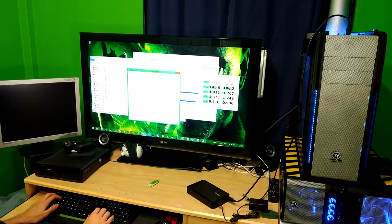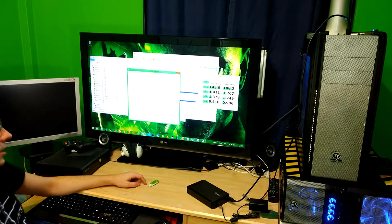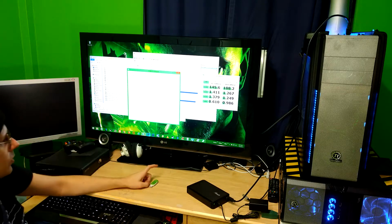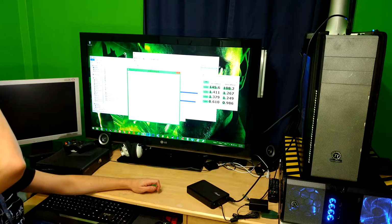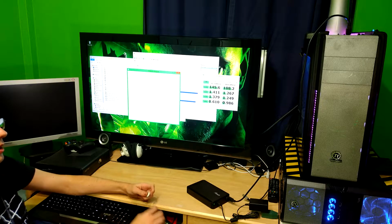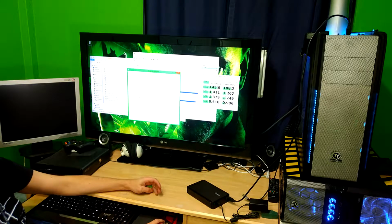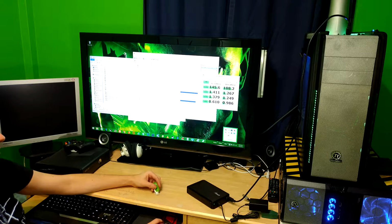Okay. Alright, so that was really strange, that the write speeds for that were almost 1, and they're half of 1 for USB 2.0, but then they're 1.1 for the SATA connection. It's kind of strange. If I wanted to put more time into it, I could do the test multiple times to see a median or average, whichever is more applicable, and calculate the math for that, but that's too much math for me right now. So let's just disconnect this and test this one out next.